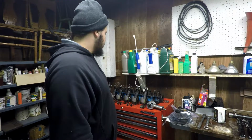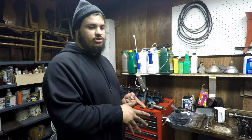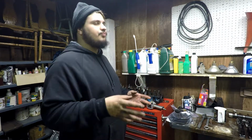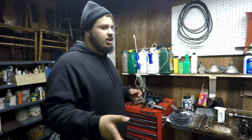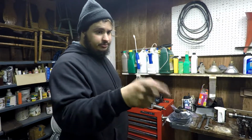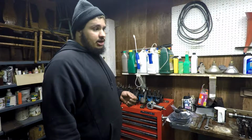After I clean it all, I guess I'll measure everything, which is very important because the kit that I'm trying to buy, they want measurements for your camshaft journals, for your crankshaft journals, for your cylinder bores, just in case that block was modified in any way. So you can bore out cylinders, and that would make the cylinder wider, and the parts you need to get need to be bigger for that. Same goes for your crankshaft journals and for your camshaft journals. They can be made to be bigger if something happens and they get dinged up and you need to bore them out, and then they're bigger, so you need thicker bearings to fill the void. So yeah, I'm going to have that stuff done.